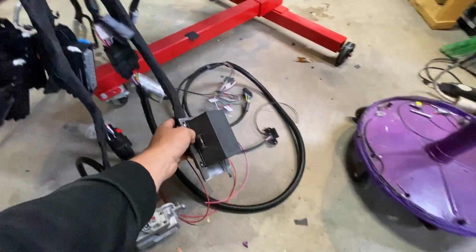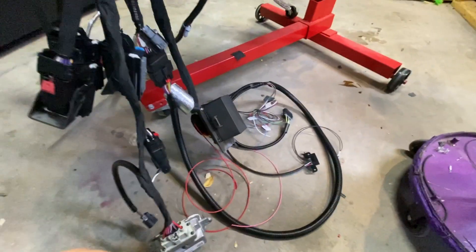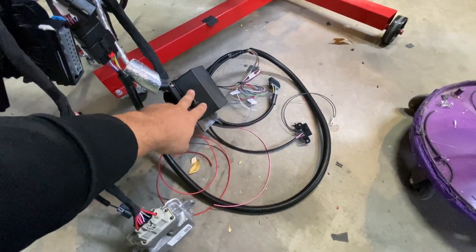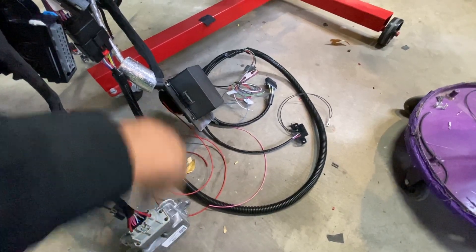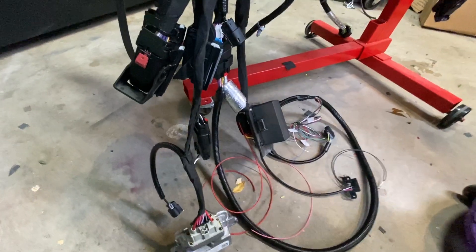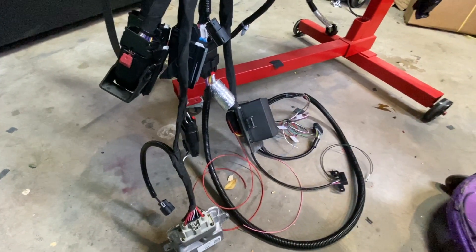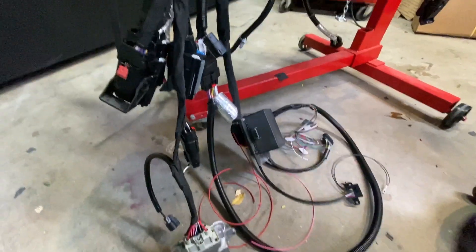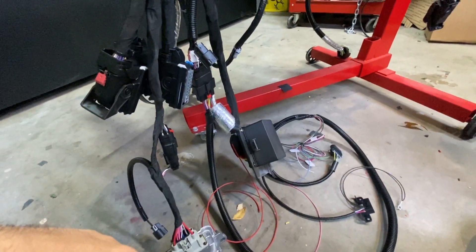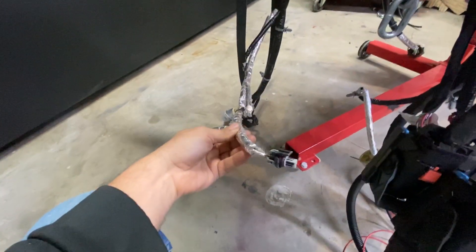This has pretty much all the goodies I can think of. It's going to have basically a one-touch start system, so it has a relay for your starter. That will get wired up to the muscle car module — you just tap the button and it will auto-start itself. It also has the AC relay in it, which will do your AC compressor, controlled through the Gen 5 ECM.